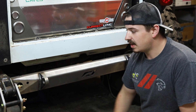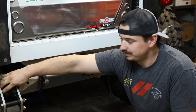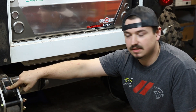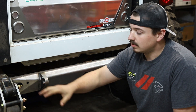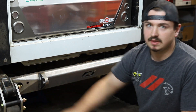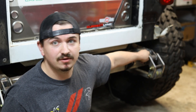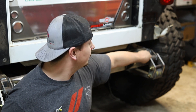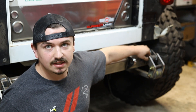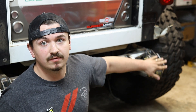What doesn't come in the box are these bolts and a poly bushing for the hanger. Now, that's a big bummer. It does state on the website that the bushing does not come with the kit. I might be wrong, but on the website it does not say these bolts are not included. So you're going to have to go pick some up. The bolts that should have come with the kit are half inch by five. You can go to Tractor Supply and they sell them by the pound. I spent $20 on the bolts, the nuts, the lock washers, and the washers, and you're going to need six total, three for each hanger.